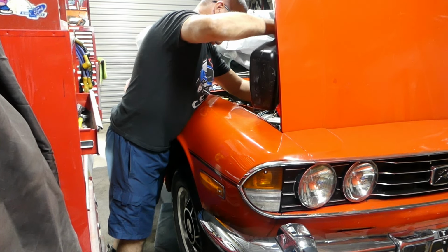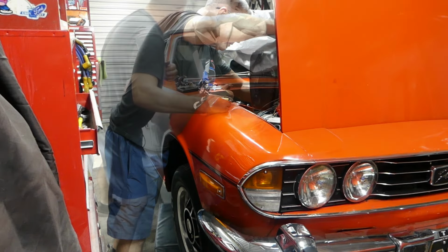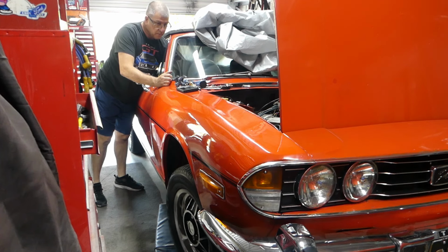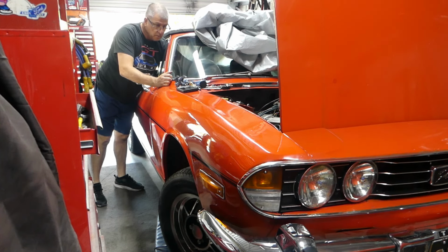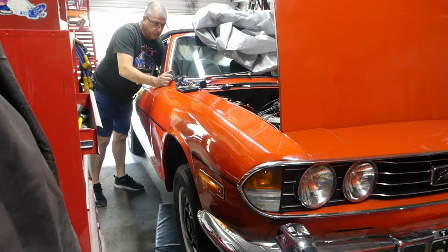That's the high pressure hose on the power steering fitted. Just need to add some ATF, then start the car up, move the steering from lock to lock to release any air. I've left the cap off the reservoir. Hopefully no leaks, and we'll be back on the road enjoying it in no time at all.